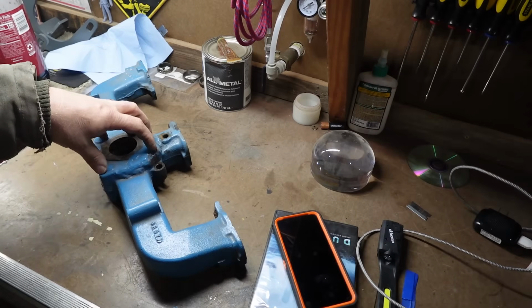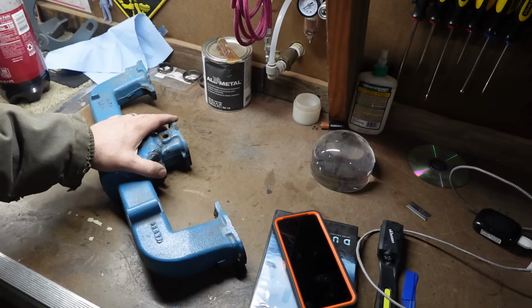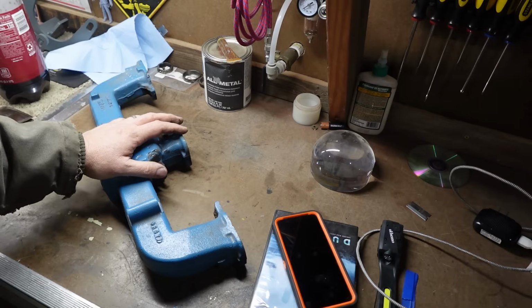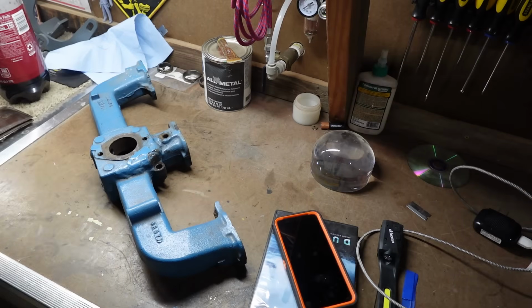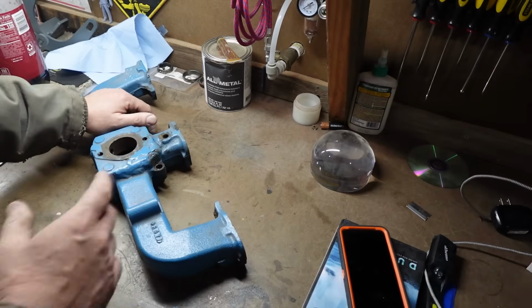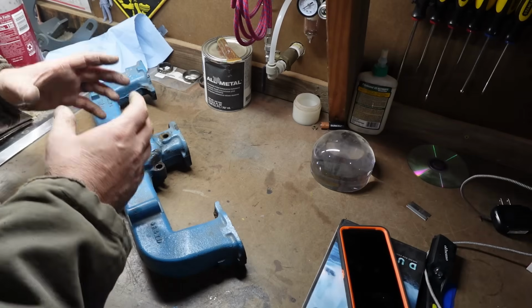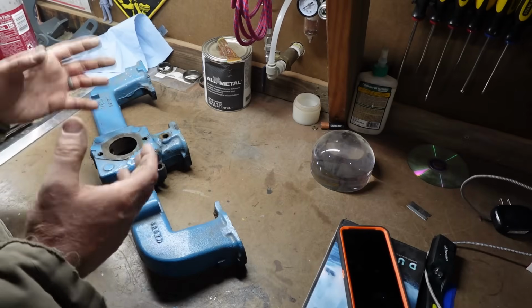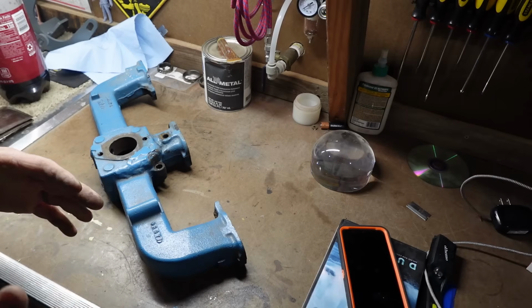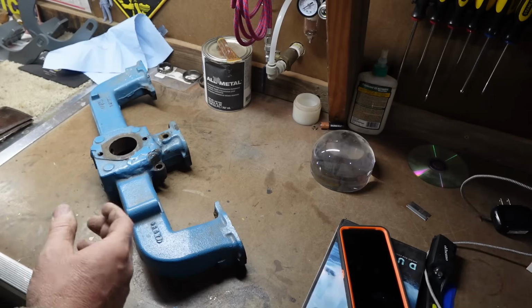And then there's the problem of over-fueling the thing. We're talking about a 292 after all. And yeah, you can get adapter plates for your 4-barrel intake to neck it down to 2-barrel. If you went the Holley Sniper road, then it regulates your fuel, so you're not going to be over-fueling the thing. And if you do a little research on their website, they have a lot of 1-barrel and 2-barrel options in the Sniper line, which is pretty cool. Ultimately, that would be really neat for a truck the way that I want to use this truck. That would be kind of ideal. But then you're talking another $1,500 to $2,000 for that.